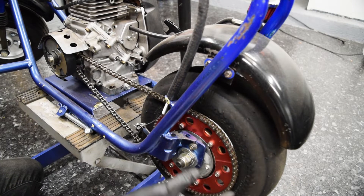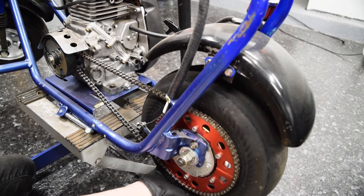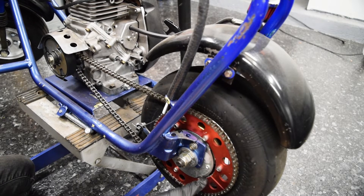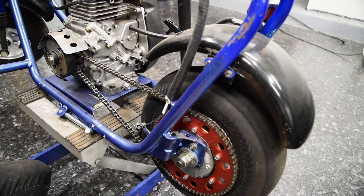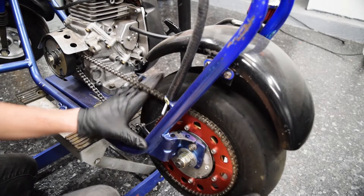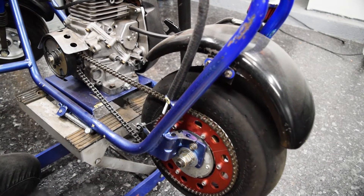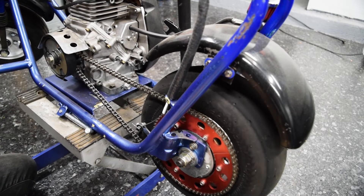There's some misalignment in the rear. I think the adapter to the rim itself is not properly aligned because it rotates fine and then comes to a pinch point, frees back up, and then hits it again. Something's obviously not perfectly aligned and it's starting to eat away at the sprocket. I don't think it's the brake itself because I already messed with that a lot. I do have other wheels on the way but they're a different size. The chain also hits the wheel when it flexes, creating a weird X pattern all along — gets worse right at the misalignment point. The tires I ordered are probably not going to fit, but they're already on the way. I also don't remember if there's a master link on this chain — I don't think there is, so we're going to have to use my chain break tool that has a bent dowel.